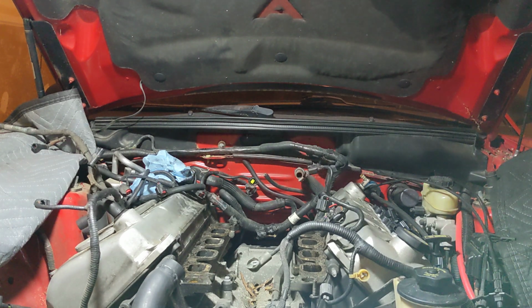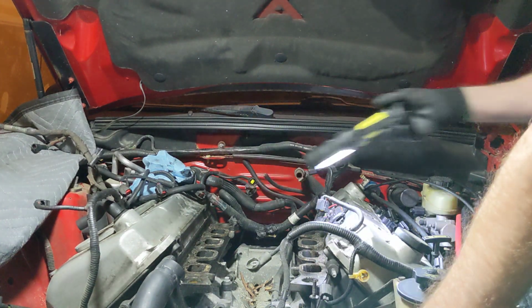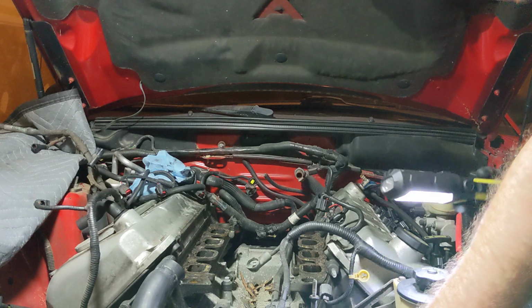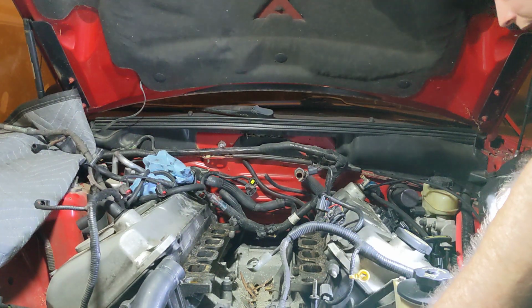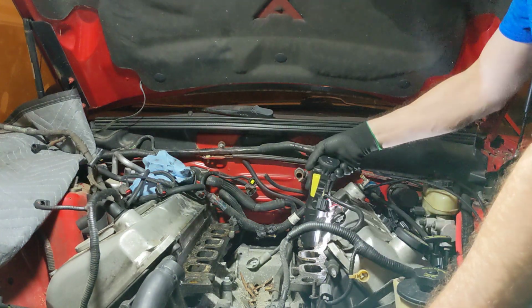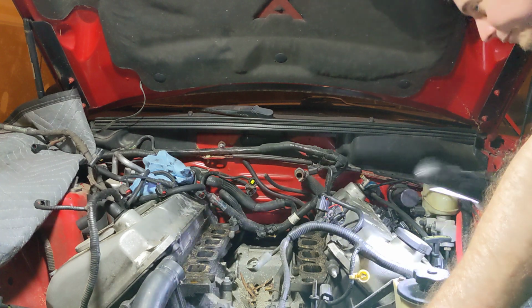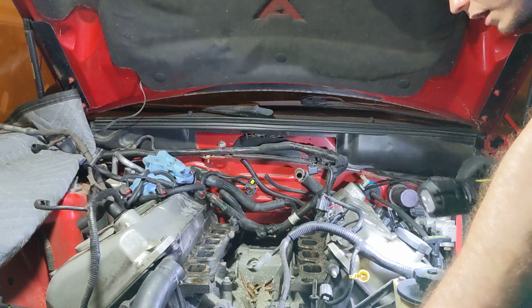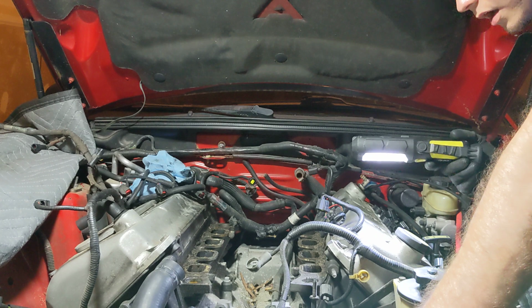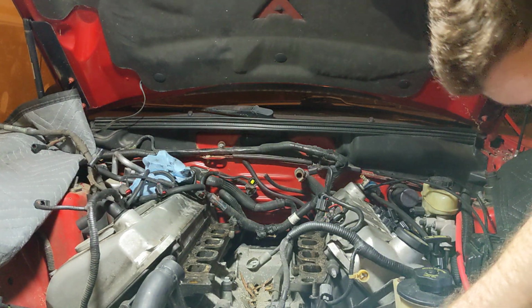But I'm still wondering, the car very obviously hydrolocked. We know that now, after pulling all this apart. There's water in the intake manifold, there's water in the ports, there's rust in them, right? So the only way that happens is water, or something else corrosive, but water in this case, because there's water sitting in this port. So what do we do about that? It's going to need intake valves. I'm going to end up having to clean the ports with a little bit of sandpaper, but that's not terrible. I don't even know what else I want to pull off.